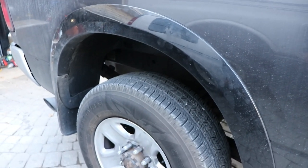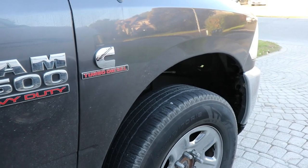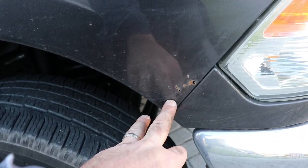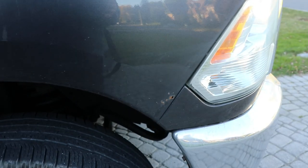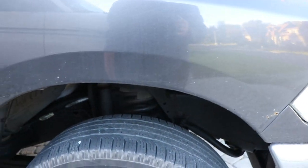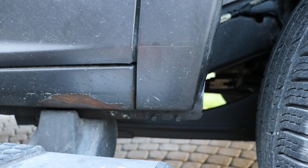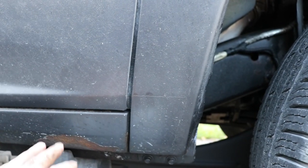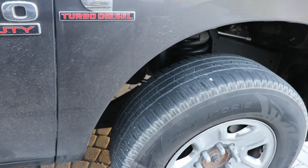Not a big deal — it all kind of goes together. I'm doing this side last because I've got to yank the turbo out, and it's a pain to do the fender liners. I've got some rot here, which is a very common location — everything just piles up in here. I'm going to be coating that in copious amounts of grease before I cover it up to make it last as long as I can, and I'll regrease as necessary to protect the running boards and rocker area.